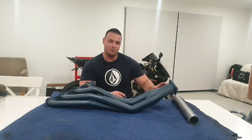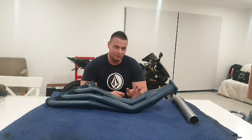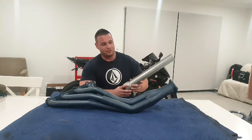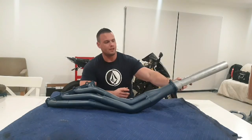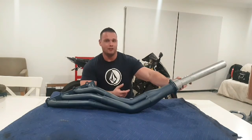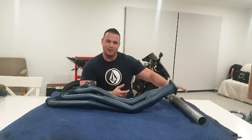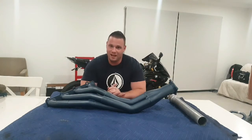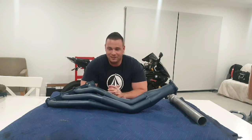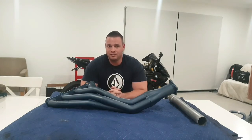The last thing I wanted to talk about was running pipes without a collector extension. This is a collector extension here — it goes on the end of your collector and basically it helps keep the velocity up out of the pipe. I've been to the drags before and dropped my exhaust off just to the headers, and my car went slower and I wondered why. It turns out I lost a lot of torque in the low end. I've seen engines lose as much as 50 foot-pounds of torque in the mid-range, which is a lot of power to give up. So always run a collector extension.